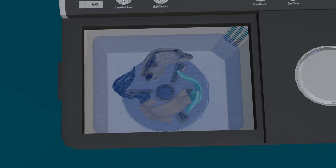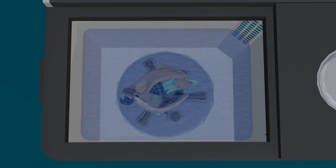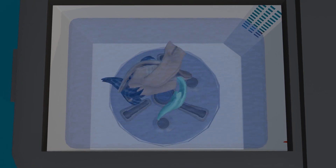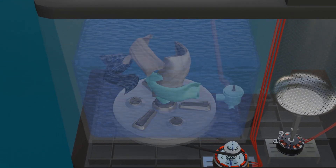So what happens when the pulsator moves forward and backward? The clothes begin to rub against one another, which allows more water to pass through the fabric. This improves detergent distribution, helping it move more thoroughly through the garments. However, there's a drawback: in top-load machines, the clothes often collide quite harshly with one another, and over time this reduces the fabric's lifespan.